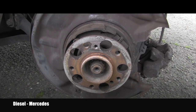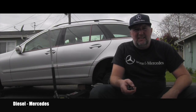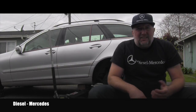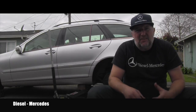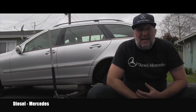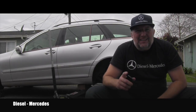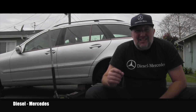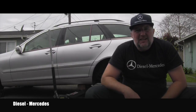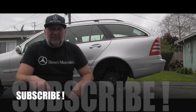As expected, all of this needs to be replaced. I'm actually surprised the inside of the rotor wasn't damaged even more than it is. This is how I inspected this one side — obviously exactly the same needs to be done on the opposite side. I wish I already had my shop open with my brake lathe so I could perfectly machine that rotor inside and out. There will be another video coming soon showing how to replace those shoes and fix everything. Make sure you are subscribed and visiting Facebook, as more videos are heading your way very soon. Thanks for watching and have a wonderful day!